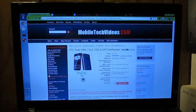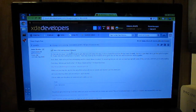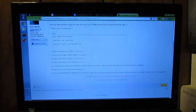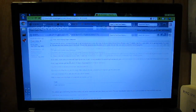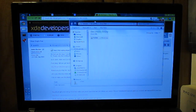After you get S-off on your phone, head on over to this XDA thread showing you what to do after you JTAG your phone. Go down to this link, let it open up, and grab the RUU file — it's the 1.15. The reason we want this is because it's what's going to allow us to actually unlock our bootloader. Click the download link and then exit out.